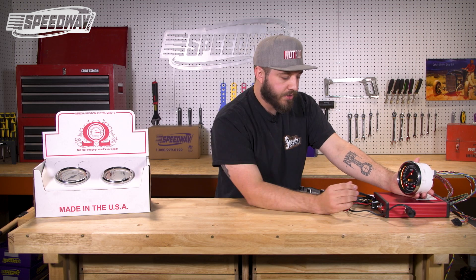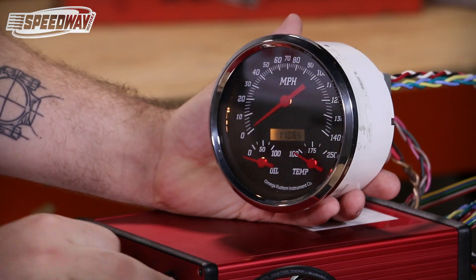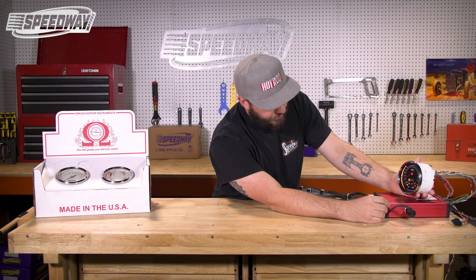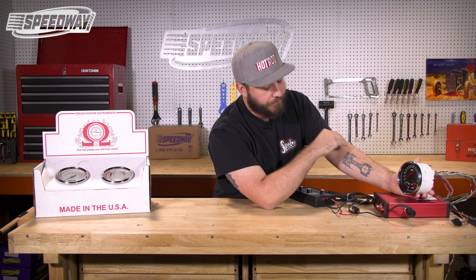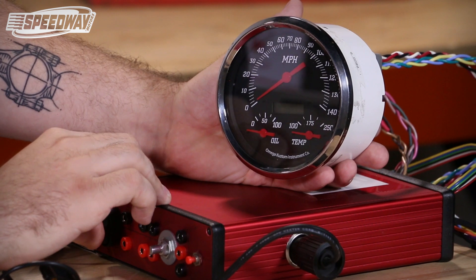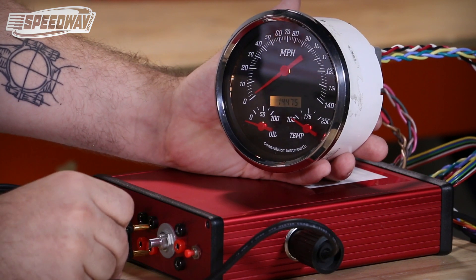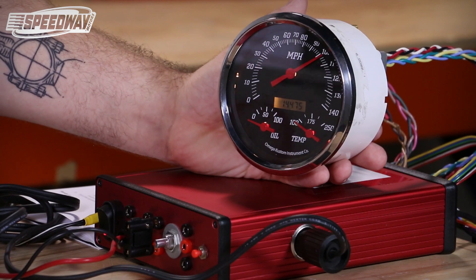We'll say we're at the end of the measured mile for this particular run. We will disconnect the signal — as you saw it popped up there — and we're actually just going to push the button one more time. The numbers will begin to flash. You actually want to turn off the power to the vehicle at this point in time. We are going to power it back on again, not pressing the push button. Your regular odometer will display as normal, and as you can see, a speed is now programmed into the unit.